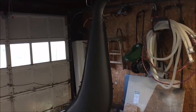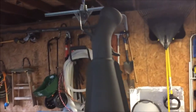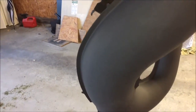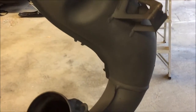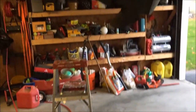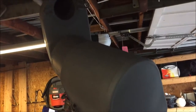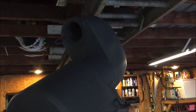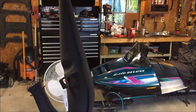Here's the pipe after three light coats — no runs, no mistakes. Take your time and it comes out pretty good. It's been hanging for about 30 minutes after the last coat and it's dry to the touch to the point where it's safe to handle. Same with the silencer can — safe to touch and easy to handle. Now we're going to reinstall it on the sled without the cover to start the process of curing it.